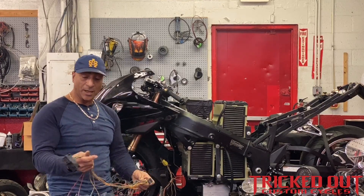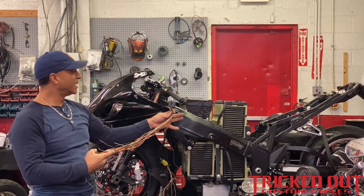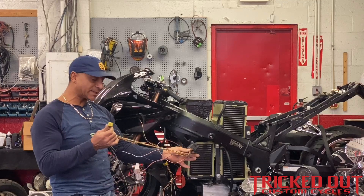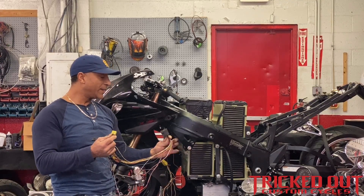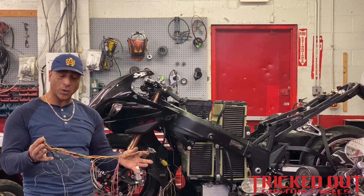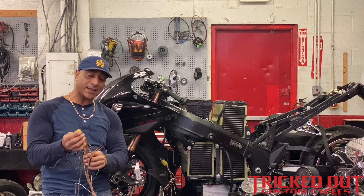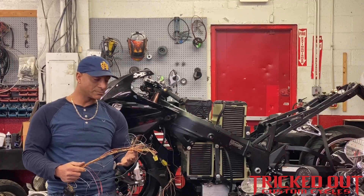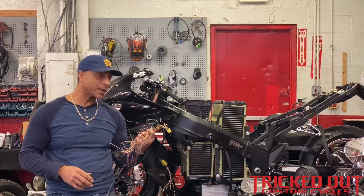We have the connector for the horn and all the turn signal wiring harness and everything we'll need here. I'm going to install this but relocate it to the back of the bike where I'll locate the relays, and we'll extend just the front plug area. Basically using this for the existing wire colors and keeping everything coordinated, so if somebody doesn't want to work on it afterwards, the factory schematic on the lights will still have the same colors. We'll get this installed and get the lights and everything working.